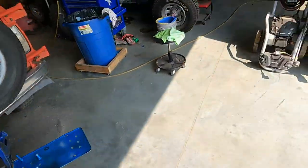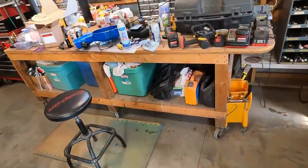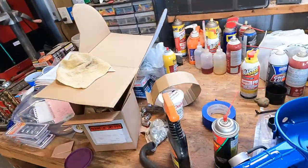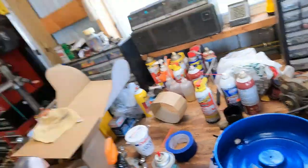And then the other issue. Nice guy, about an hour away, had to go and drive to him. The other issue was the lug nuts were metric, and our cart is old enough that it's got standard half-inch thread lug nuts. No big deal, because we can buy standard fine thread half-inch chrome lug nuts for it, which I've done.